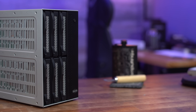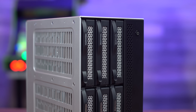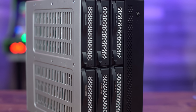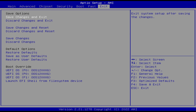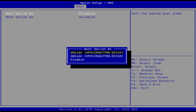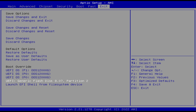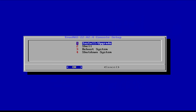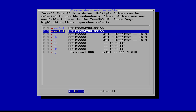Now onto something with a little bit more control — the Terramaster T6, running a Celeron N5095 with a standard AMI BIOS, all with video output over HDMI. So things are already starting to look up. Much like the DS923, the system does have eMMC on board, as well as a pair of M.2 slots for NVMe drives. Powering on the system reveals it's just a PC, and entering the BIOS allows us to both enable the NVMe disks as boot devices and then boot into the TrueNAS Scale installer. I'm able to select my NVMe drives for RAID 1 installation, and everything went exactly as I'd expect on a normal PC. So let's give it a reboot and jump into TrueNAS.